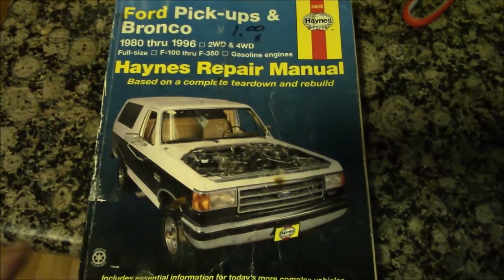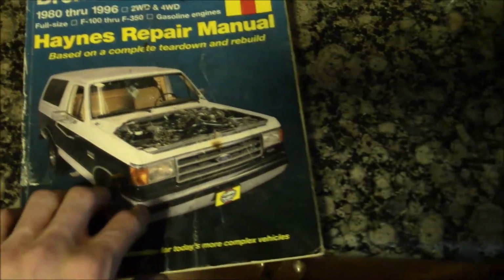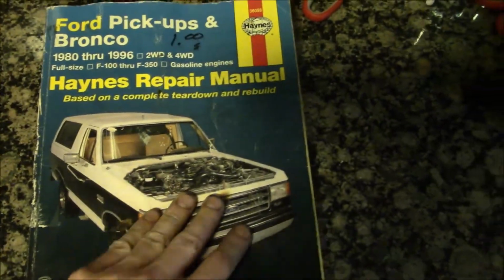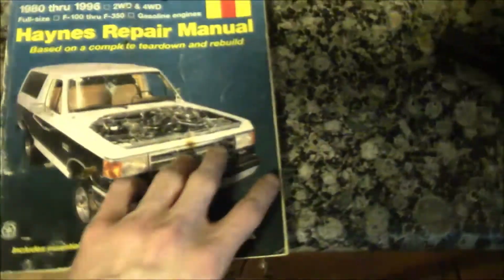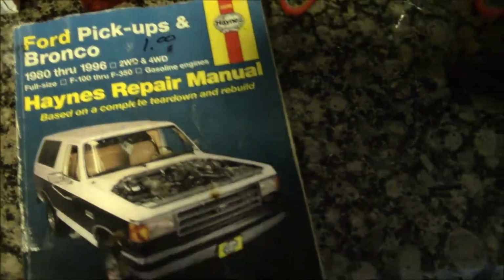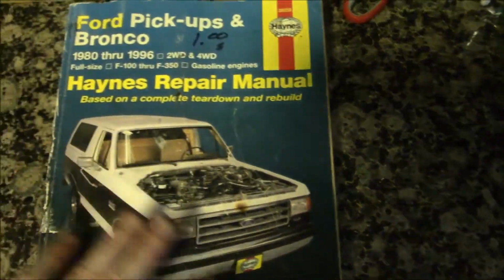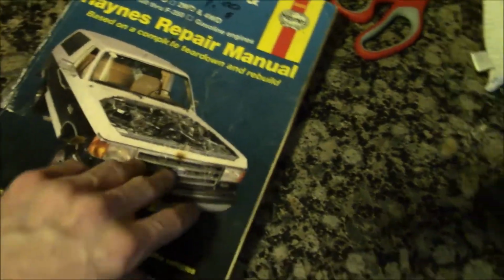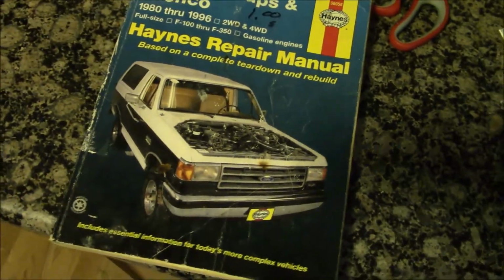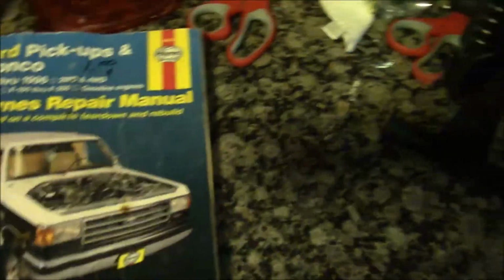Sorry guys, one other quick thing I forgot to mention is, especially when I'd go on longer drives like out to my buddy's shop and back, I'd notice a burning rubber smell in the cabin of the truck, which I suspected could have been from the old belt slipping. So I'm hoping that's the case and that it's not a result of a dragging brake caliper or something like that. So I'll try to see how that does once I start driving it again.